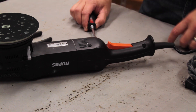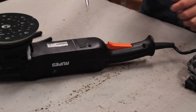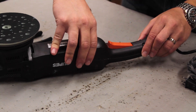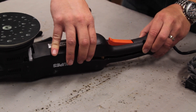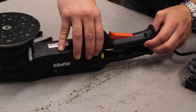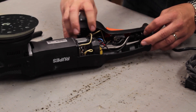To get to the power connectors inside of the handle, you simply take out these four particular screws on this model. Now the last screw is loose — carefully remove the housing. And that gives you access to the connections.